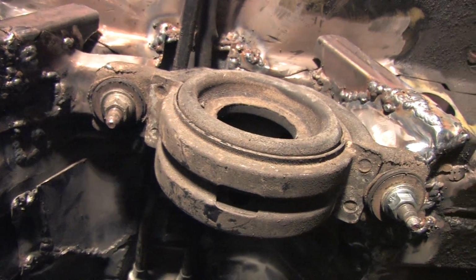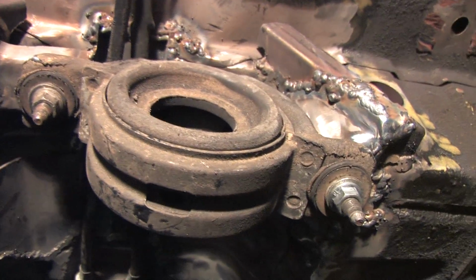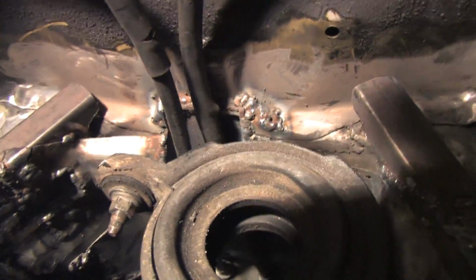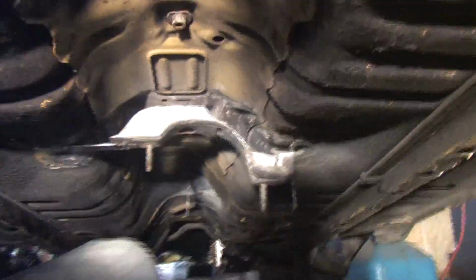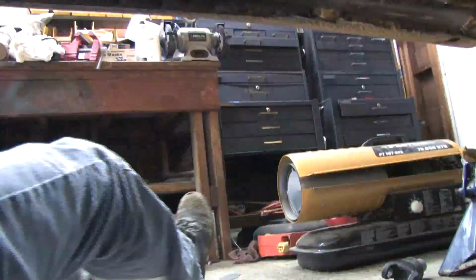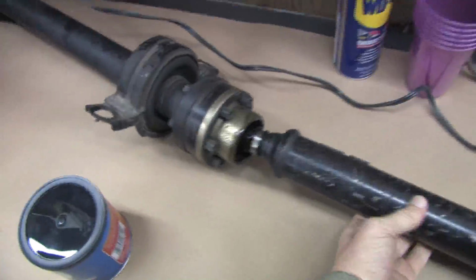In the previous episode, we permanently installed this rear carrier bearing mount but left it unfinished. In the bonus round, we hacked a tunnel for the e-brake cable so they wouldn't get pinched going over this mount, but the front mount didn't get permanently installed. Why? Why, you say? It's because the position of the front and rear carrier bearing mounts are what centers the Lobro joint.